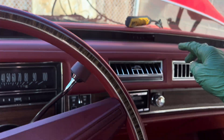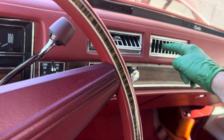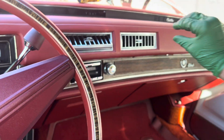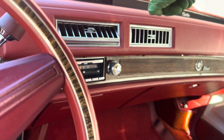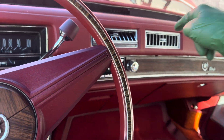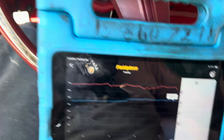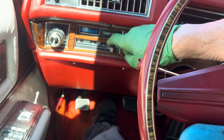You never want your temperature reading taken off the surface, because any time you put a temperature sensor on the surface like this you're getting entrained air — the air that shoots out sucks all the surrounding air into the path, mixing it and giving you a false temperature. The only true temperature reading is way down the duct. Our temperature is back to 49 degrees now.